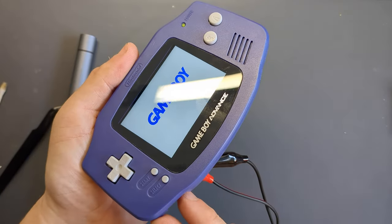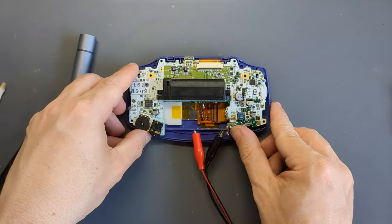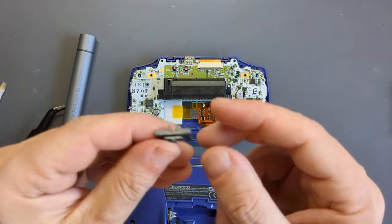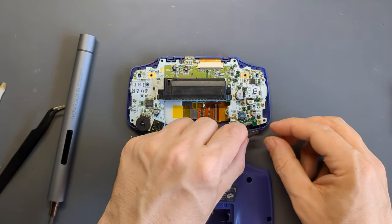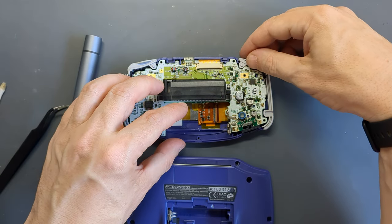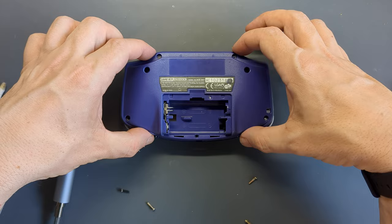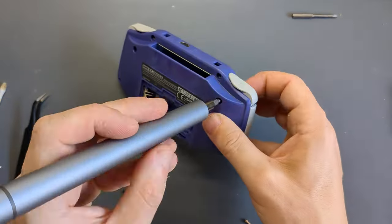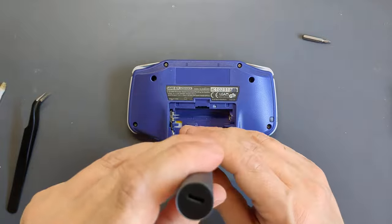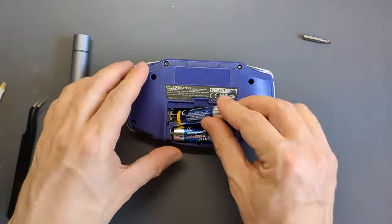Now if it doesn't work, don't despair. You should be able to reflow those solder points with your soldering iron and a little more flux, perhaps adding a little bit more solder if needed, without having to remove the motherboard all over again. Keep doing this and keep testing until you get your desired result. If you don't have the test kit, you can just pop the back shell on temporarily and put the batteries in — no need for shoulder buttons and screws to be in place. When you've established it's working, it's time for final reassembly. Carefully check your switch cover fits in place over your new switch, then add the two side bumpers and the shoulder buttons before putting the rear shell in place. Make sure everything fits securely, wiggle in your L and R buttons to engage the hinge if need be, and then reinsert your six tri-wing screws being careful not to go too tight — just until you feel that bit of resistance. Finally, put the black Phillips screw back in place, insert your batteries, replace your battery cover and give it a test.